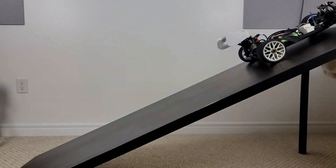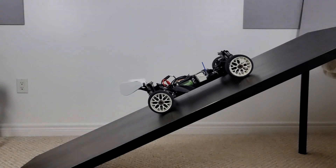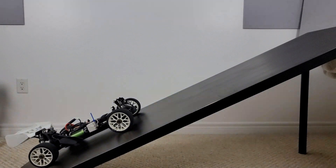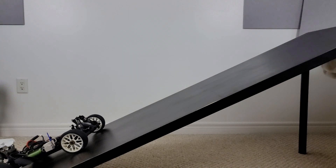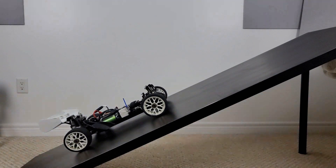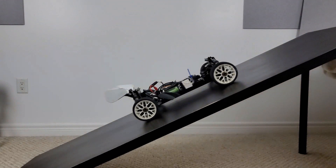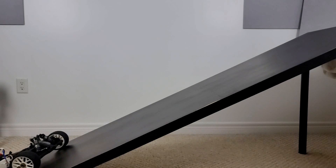We'll bring it back down so you can see the synchronization process again as we send power to the motor. We send power, then let off, and as soon as we get too slow we lose synchronization. The buggy actually slides backwards because it doesn't have enough power to get up the ramp. We steadily increase throttle to climb back up, getting minor wheel spin. I'm really trying to be very slow on the throttle, which is why we ended up slipping to the bottom. This type of action is typically referred to as cogging in the RC world, and this particular power system actually has one of the best sensorless synchronizations I've seen — so chances are you'll see even more issues in your specific vehicle.